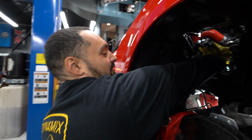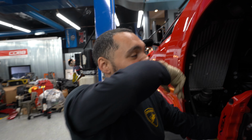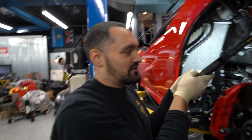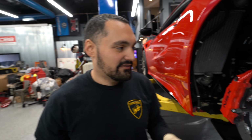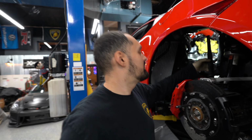What's nice is that they don't put any coolant feed or return on the other side of the turbo, so you don't have to worry about trying to get it between the block or anything. And if you look right here, it's just the 4-bolt flange to the head. So we're going to pull those 4 bolts out, and then hopefully I have enough room to pull it towards the firewall to get it off the downpipe without having to remove the downpipe or pull the exhaust back or anything like that. Sweet. So I gotta pull these 4 off the manifold, and then we're getting close.